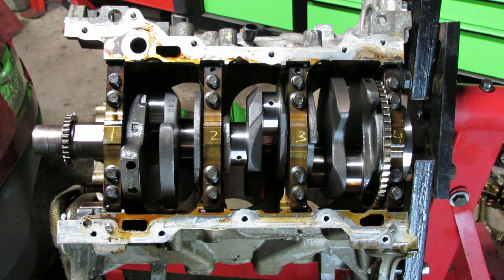The first round of bolts would be the inner bolts. The first pass would be 15 foot-pounds, and then the final pass would be 80 degrees. I personally have a torque wrench that does both. I've seen guys put a paint mark and calculate 60 degrees — if you're good at that, that's another way to do it. But I have a digital torque wrench that tells me the exact degrees.